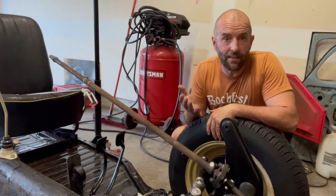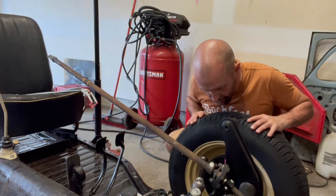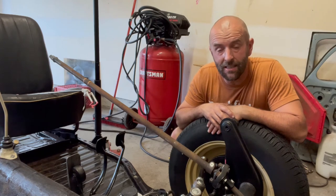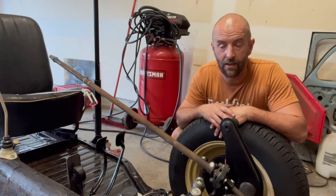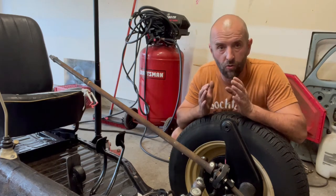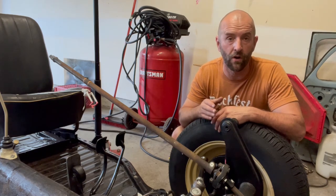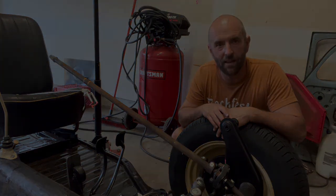I got everything back together, put the tire back on, set it back down on the ground, and when I started to jingle it around there's no more of that clunking noise - so that was it. Remember: if you're restoring a Volkswagen before 1960 - that's when they made the change and introduced the rubber O-ring - for those earlier ones it's a little bit different. That diagram can be found in old shop manuals; check out TheSamba.com, which has some technical resources for pre and post 1960 as well. Hope this helped - thanks for watching!